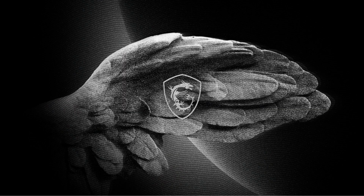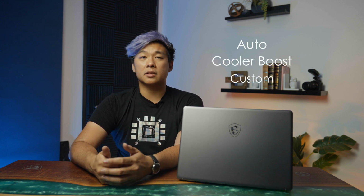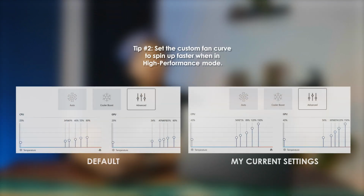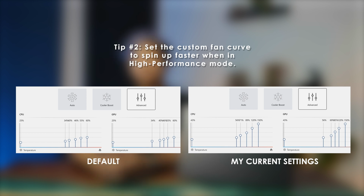When you're able to set up an editing station at your hotel or wherever you're staying, you can switch back to high performance mode since you won't have to worry about battery life. What's nice is that within the MSI Center Pro application, you have 3 options for fan control when in high performance mode: Auto, Cooler Boost, and a custom fan curve. Auto is the default, which the laptop will ramp up the fans on its own as the name implies. Cooler Boost forces the fans to run at maximum speed, and what I would suggest for tip number 2 is setting the custom fan curve to something like this. Unless max fan noise isn't a concern to you, setting the custom fan curve to spin up a little bit quicker is a nice middle ground between auto and cooler boost.